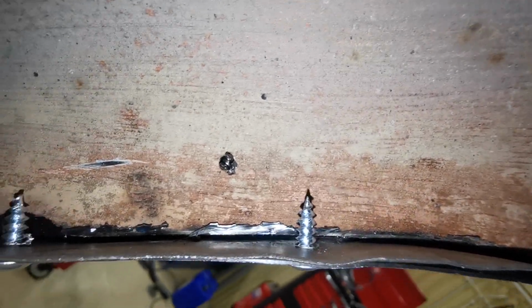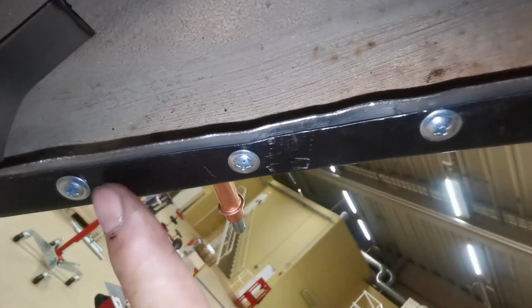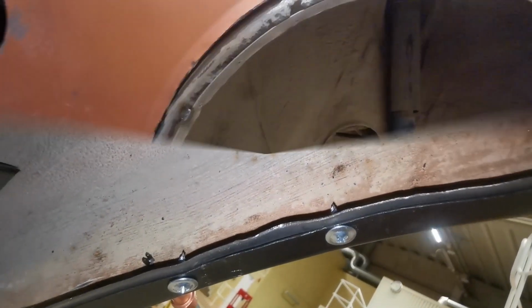there I'll be able to weld. So I'll be able to go around and kind of tack it in place in a few places. There I'll be able to weld, for example. Most of that I'll be able to tack it in place as tight as I can, and then I'll be able to take out all of these screws and take the panel away, leaving this in place, and then I can replace the metal back there. So that's the next job.